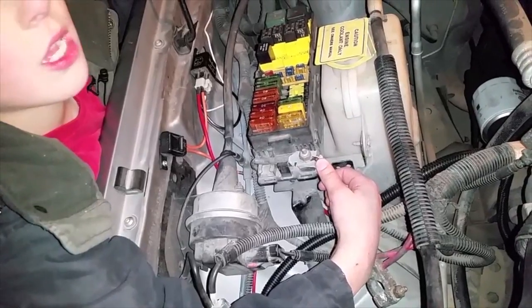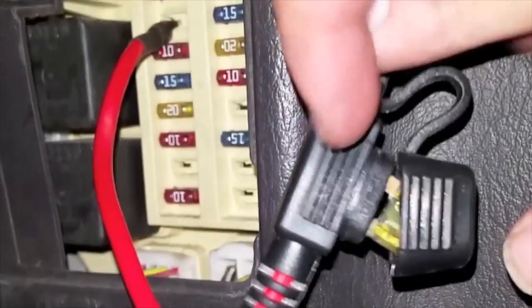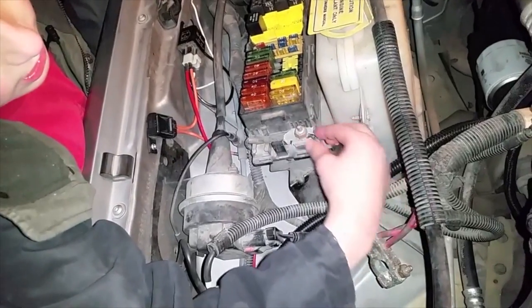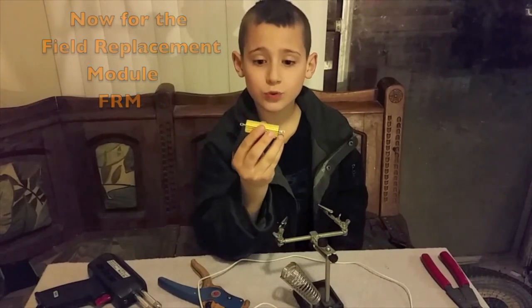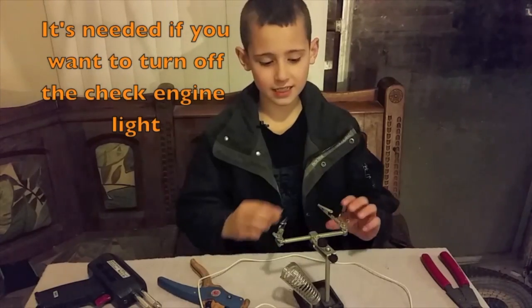The fuse panel is on the passenger side of the dash. You don't want it running while the car is off, because that would drain your battery. That's a 12 volt power supply. You can tuck it in nicely and wrap it around the dash, through the firewall, and take it to your relay. We powered the relay off of this one here. This is a field replacement module, and it tricks the computer into thinking it's in charge of the alternator. We're going to solder this on because it doesn't have any easy connections.